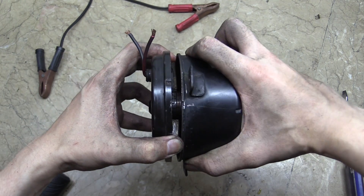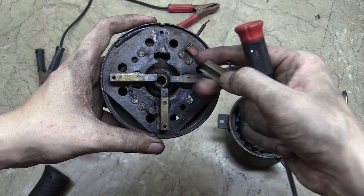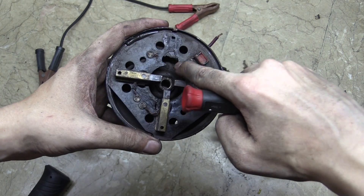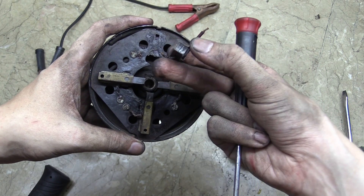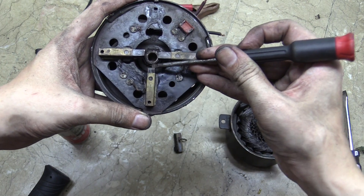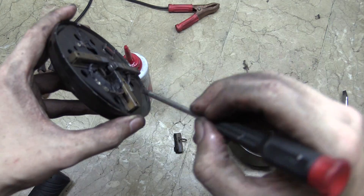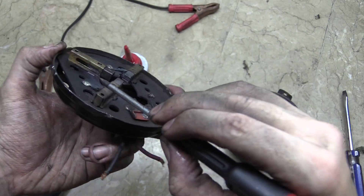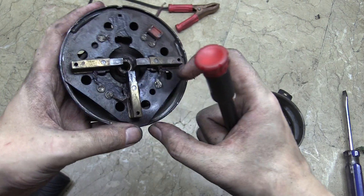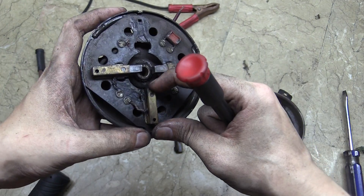Be careful because there are brushes here. On mine I've only got three of these — there should be four. One of them broke off when I was opening this up because it's so old it's pretty much just falling apart. One brush was jammed in, and the same on this side — this one was also stuck. So what I did is put a little bit of general purpose oil on the spring and on this side, then coerced it out with a screwdriver and now it's good again. Try to avoid getting oil on the contacts if possible.